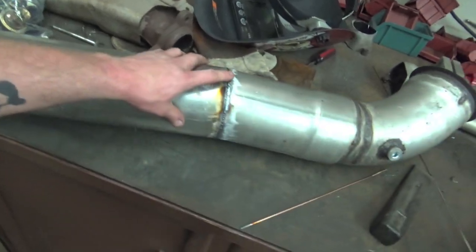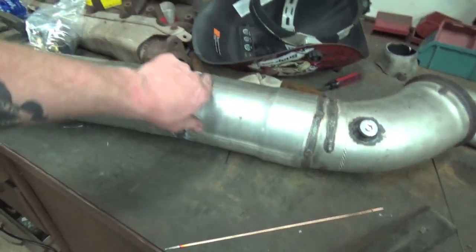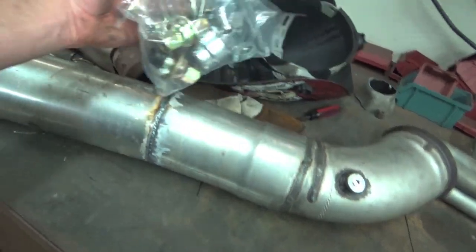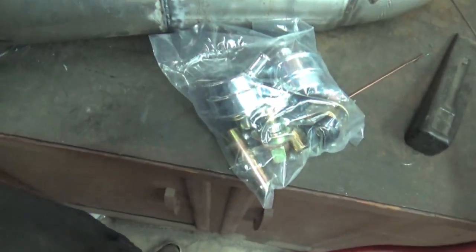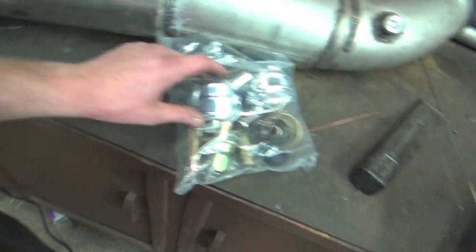Here's our down pipe right here. I just got done mocking this up, adding a little bend to it and TIG welding it up. Somewhere in probably this location we will be welding in these guys right here at a 45 degree angle — two of them, about three quarters of an inch in. These ones right here are actual check valves that thread onto the fittings welded to the down pipe. Then you run 5/8 heater hose from here. They come with new crankcase breathers but we're going to use the stock ones because those are drilled out already — just a straight hole from the motor, no baffle, no PCV, just a hole in the valve cover. And that's what you need.